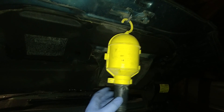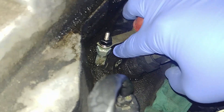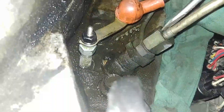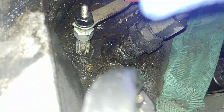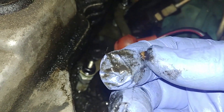It's the next day — daylight again and we will continue. The penetrating oil hopefully did a good job. As you can see, there's still lots of grease and sand, and even a little rock — you definitely need to clean that up. This is what can kill your engine, and that's why cleaning is such an important part of the glow plug replacement process. Unfortunately, many times people rush and don't do a good cleanup, and then their engine fails prematurely.